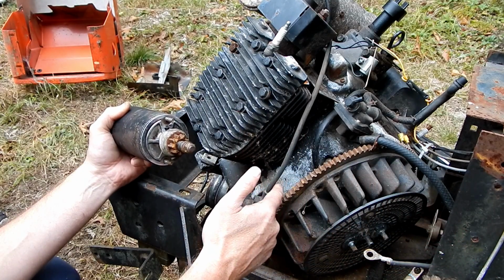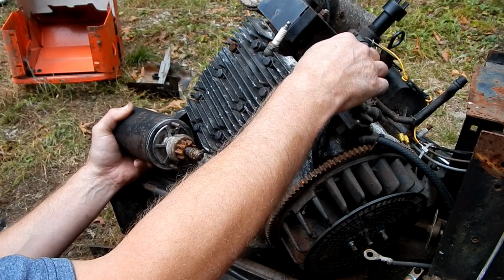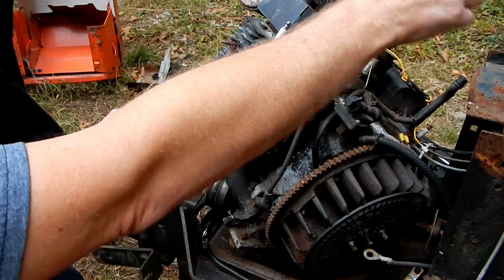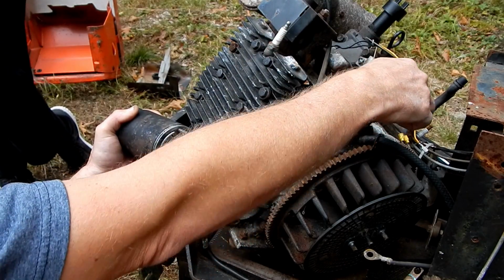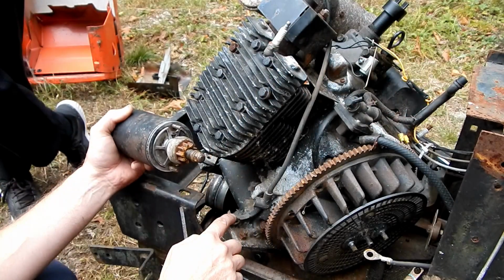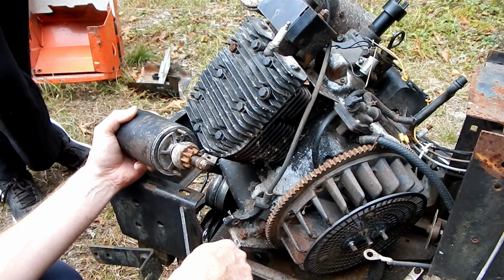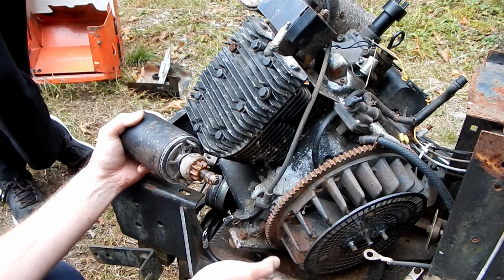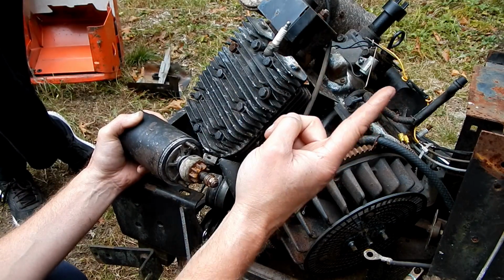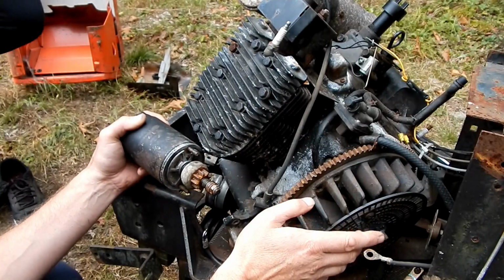And that can happen one of two ways. It can go through the cable that goes to the negative terminal on the battery that's bolted to the top at the manifold, but it can also follow a path through the frame of the tractor because the block is bolted to the tractor. The reason why I know that they're using the frame of the tractor as a ground is because the solenoid return path to ground is where the solenoid is bolted to the frame of the tractor.